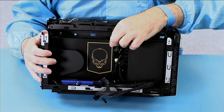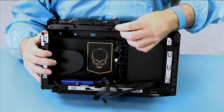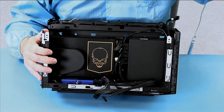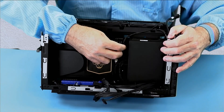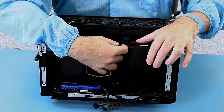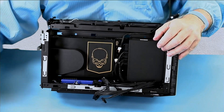The cables I'm going to remove — I'll start with the high-density cable at the top, pulling it straight away from the element card. This has a USB 3.2 Gen 2; it's a very precise cable with twisted pair and specific lengths, so we don't want to damage that. Next we're going to remove the power cable for the element — there's a little locking tab. For the element itself, the locking tab is between the power supply and the cable, so I'm depressing that while working it out. And there is your cable with its locking tabs.